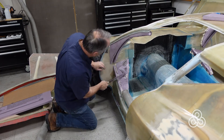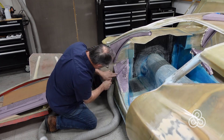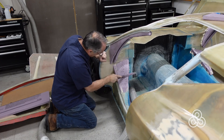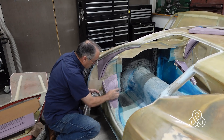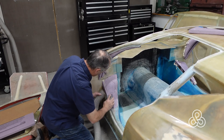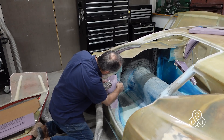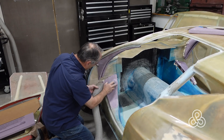The fabrics do not like to make hard 90-degree bends. Rasp it down and then go back with 60-grit sandpaper — that's plenty smooth for foam. Any finer than that just seems to rub back and forth without taking anything off. Work it over nice and smooth. You'll often see me with my vacuum system — it's one of those sawdust collection systems used in wood shops, mounted outside to keep the noise down. It works great for gathering foam dust, fiberglass, and general shop cleanup.